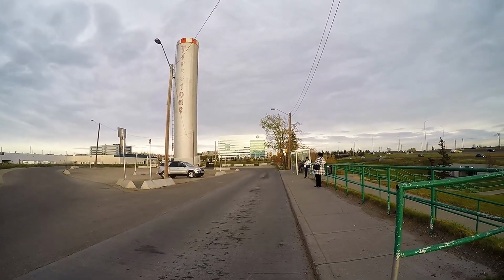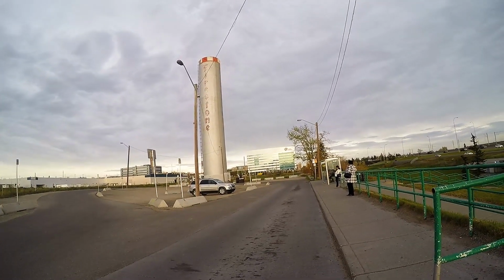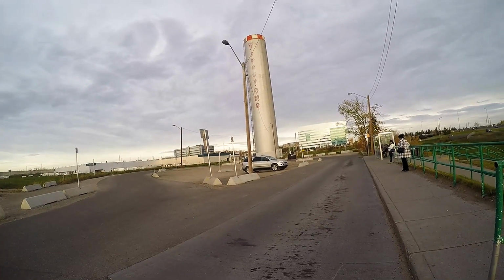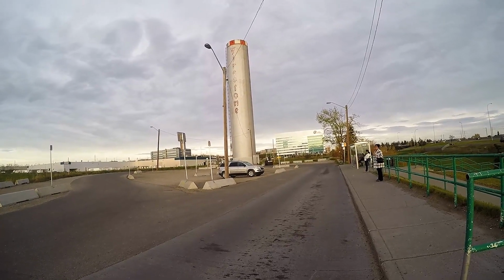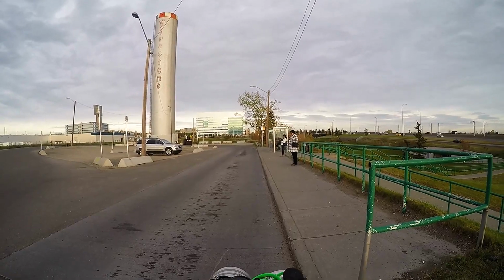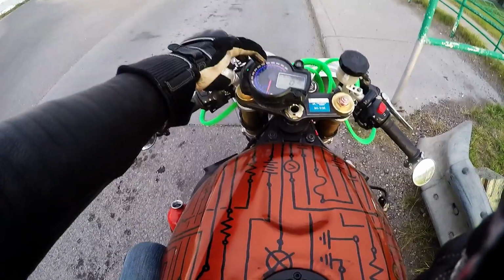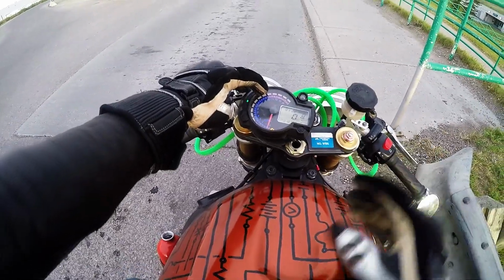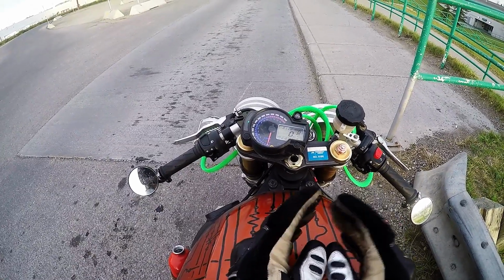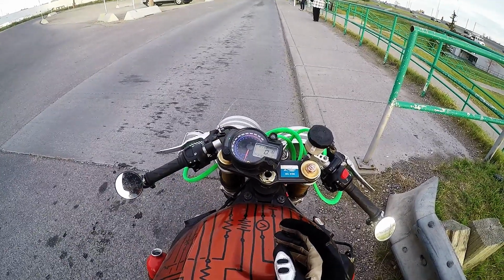And that's ideal because you'll have the most power coming out of the corner, of course, but also that's the smoothest in terms of when you let off and when you let on, you're still in the power band. So the input into the bike has the least differentiating effect. So if I'm down here right before my power band, hope you can see it, and I give it a little bit of gas, suddenly I hit my power band, and that little bit of throttle, let's say 5 degrees of throttle, has a greater effect than 5 degrees off the throttle, which maintains me outside of the power band.